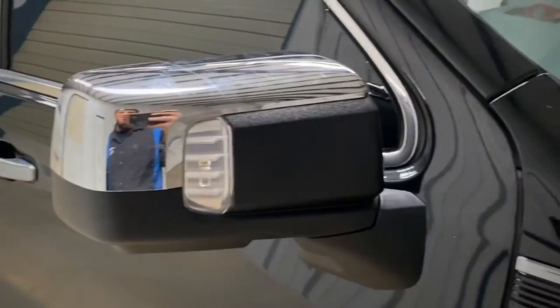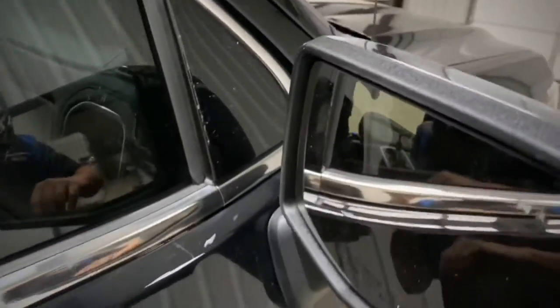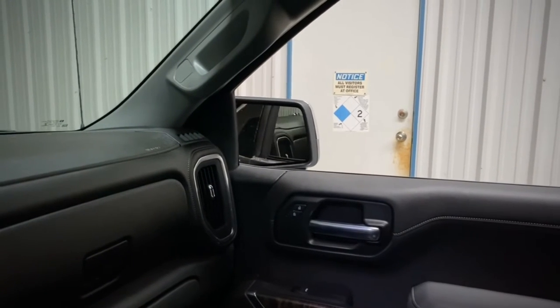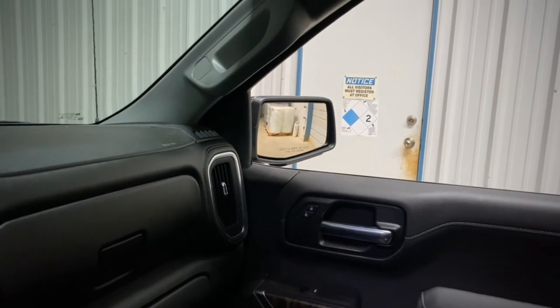All there is to it is you pull those bolts out, undo the connector — the little push tab for the connector is on the top, nice and easy to get to. I got the chrome piece swapped over; this guy literally just pulls straight out. Be careful because the tabs aren't very strong. All you do is pull the bolts out, put the new one back in, have someone give you a hand holding it, put the nuts on it, put the connector on, and she should be good. Pop the panels back on, test the tilt, check adjustment, light on the bottom is working. We got it all back together and in working order — that's where we're going to cut this video off. Thanks for watching.